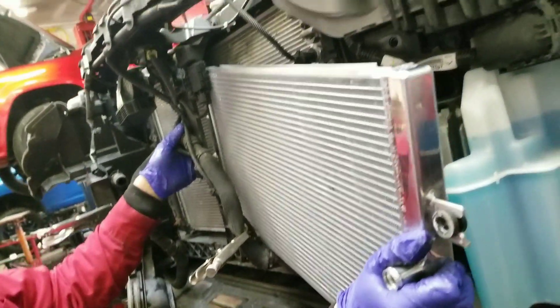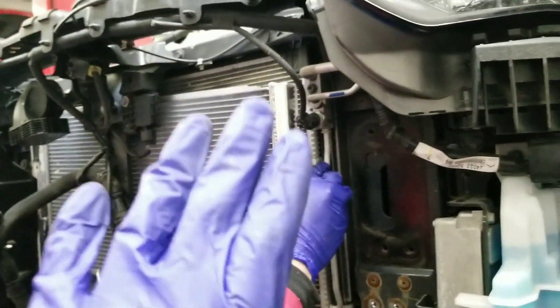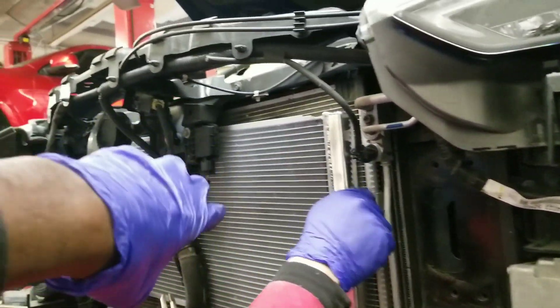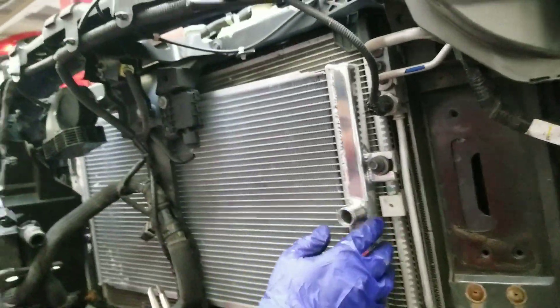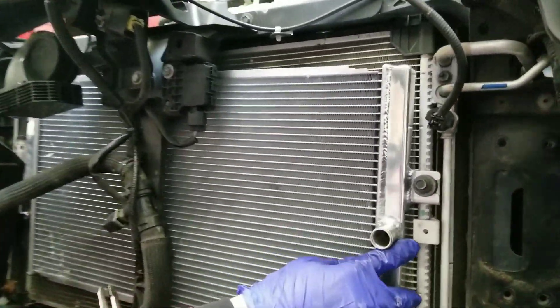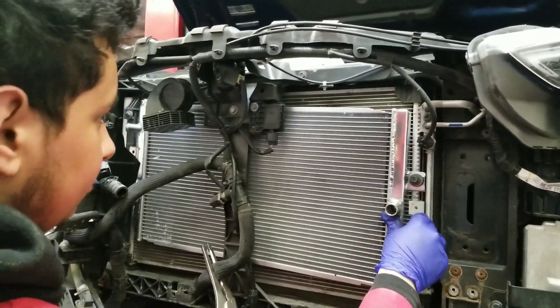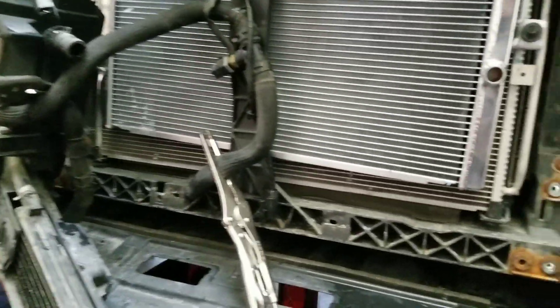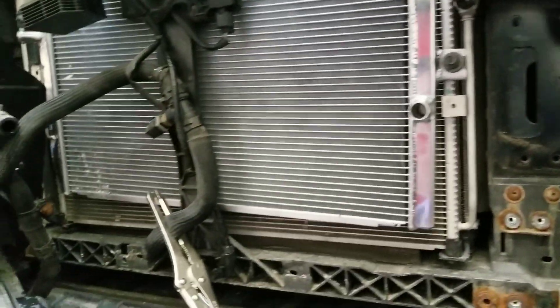It's going to be a tight fit. When you're pushing it in, you're going to have to pull on this plastic piece a little bit to give you some more room, but just keep knocking it in there. It's going to slide across the condenser — it is fitting really snug and tight. Be careful not to break this harness too. Right now we're pretty much halfway past there. What we're going to do next is connect it and start filling it.